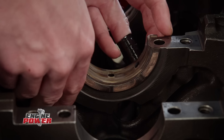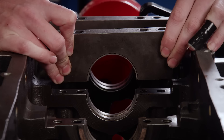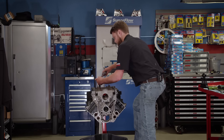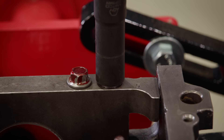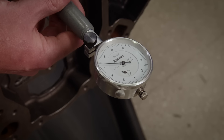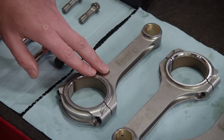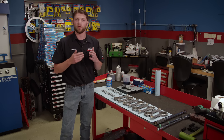With everything final cleaned, we can begin assembly by measuring our main bearing vertical oil clearance. These Clevite 8 Series standard bearings came in our Summit Pro-LS kit. The main caps are installed and torqued into place with a used set of torque-to-yield main bolts — we'll use a new set of fasteners during final assembly. Torque-to-yield fasteners can generally be re-torqued up to two times, following GM's specification. With the dial bore gauge zeroed to the main journal size, we can measure our main bearing oil clearance — they all come in between 27 and 29 ten-thousandths. The next thing is to set the rod bearing oil clearance using our Summit Pro-LS rods.